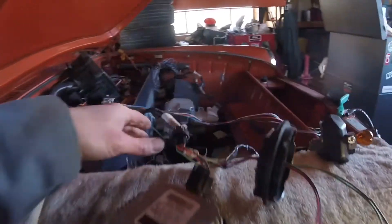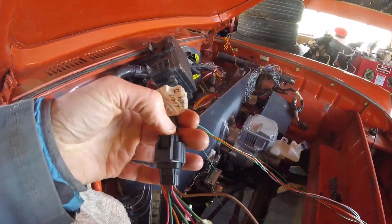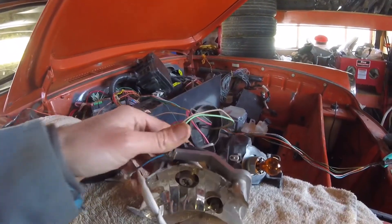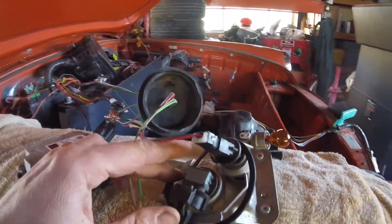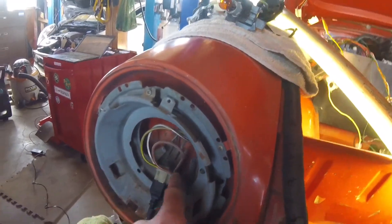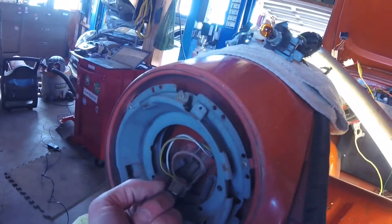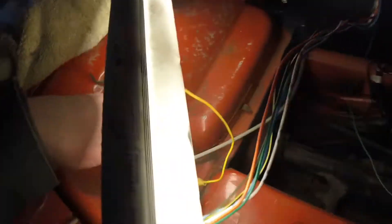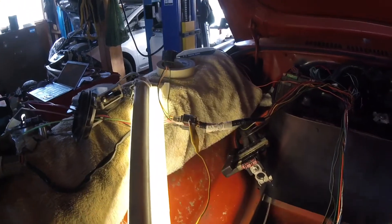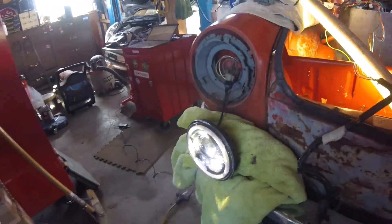Pin one is red and pin two is pink — yes, pin one red, pin two pink, so now we have some reference. Pin five is yellow up here, brown down here. This looks like maybe halogen highs, which sounds familiar. So this is the highs. Got it plugged in, ground is grounded down there with the stock VW screw, and then the yellow-black is very temporarily wired up to the pin that I believe is low beams.